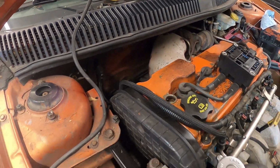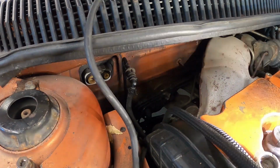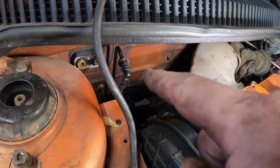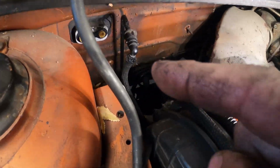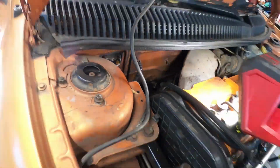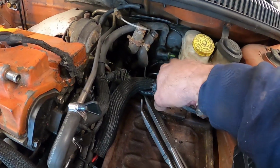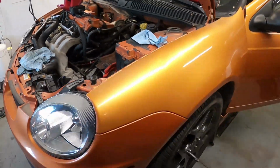It's probably a little dark in here. We have the coolant bottle out of the way. The AC part out of the way. The line there, and we have the bolt, the nut that is behind the one that holds on our fuel. Got that off. There's one there. There's one over underneath. Then there will be your vacuum line that connects here and your two vacuum lines. That is ready for the dash to come out.